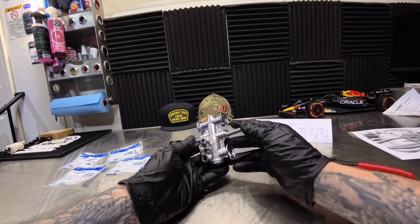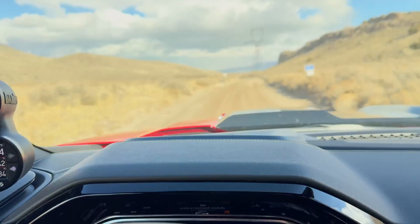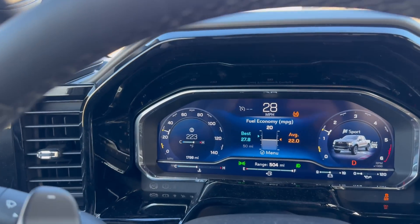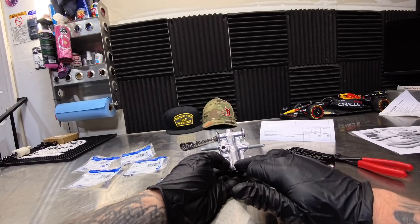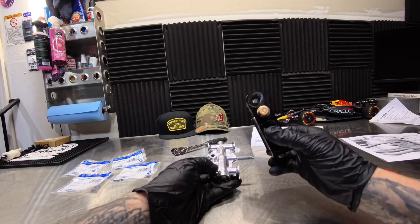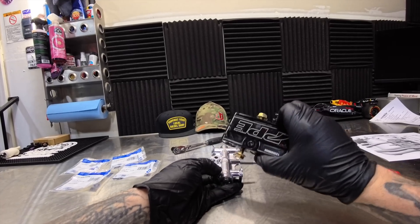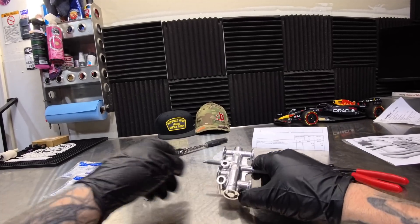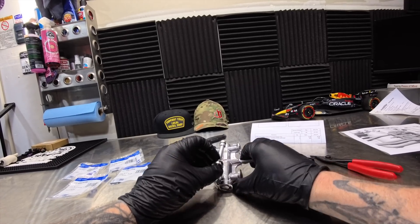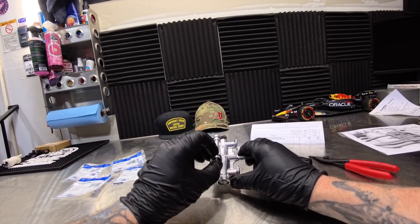This valve right here is the reason why we get such high transmission temperatures in our 10L80 on the 3.0 Duramax diesels. In this video I'm going to talk about the factory valve and why I feel like this is a big problem. We're going to talk about the PPE block that's a straight-through design, which I absolutely love, but there is one little concern that I have with that, and then we're also going to talk about this bypass delete kit right here, which is a barbell that's going to go inside there.